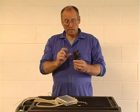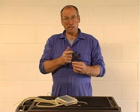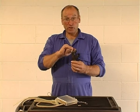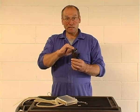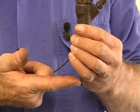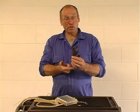It's absolutely critical that the amount of leakage is both correct and balanced across all injectors, because should the leakage be excessive or out of balance, it will affect fuel timing and quantity of fuel delivered. That's a critical test.